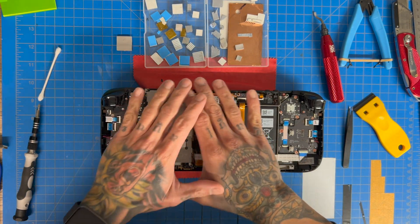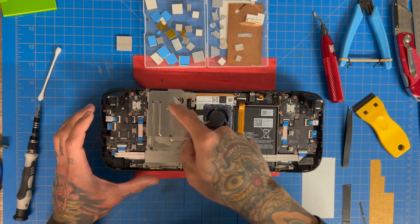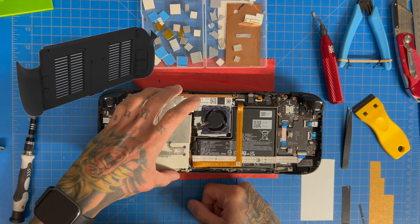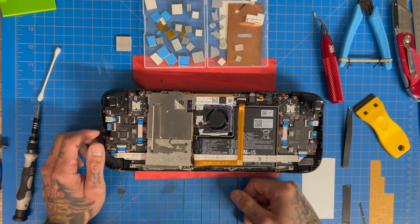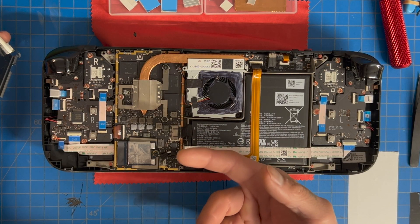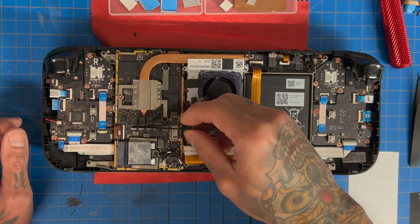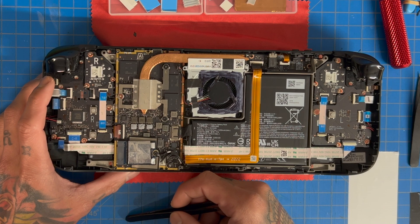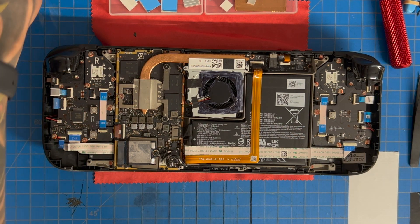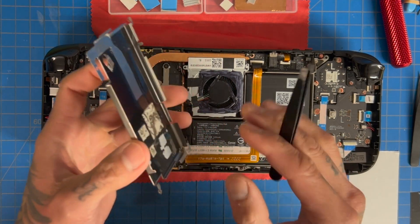When our heat shield is in place, imagine the back plate is on — there's a slot here with a bunch of holes for air to go through. Air hits here, hits this air channel, goes up and into the fan. But since we cut a hole on top, that's kind of an issue. There is a back plate sold on AliExpress that has vent holes cut along the sides, and that does help with air resistance quite a bit. But it runs into an issue where your important components — your controller right here, your VRMs scattered around here, and your MOSFETs down here — are kind of not actively cooled anymore.